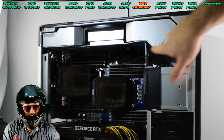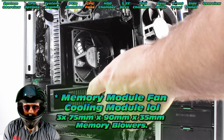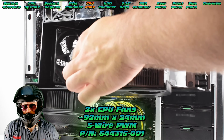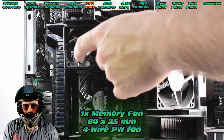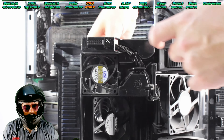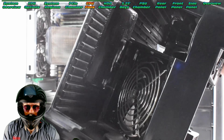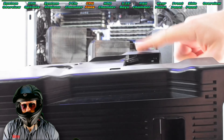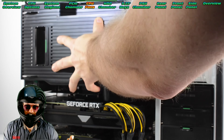Very important on refitment — make sure you look for flush fitment. Here are our memory modules. This particular one is loaded with lots of fans. I've tried my best to match them up with the exact items, which means you can find the parts if you need to. I've never had one of these fans fail, so that's a good sign. One little detail — this plug can be a little problematic. If it makes poor contact, your fans may run at max speed or may not run at all, and you'll get problems booting into your system. We've got our two green handles — simply slot that into place. The little power connector is in the top right corner; once it connects up, make sure you give it a good nudge and usually it runs without any problems.